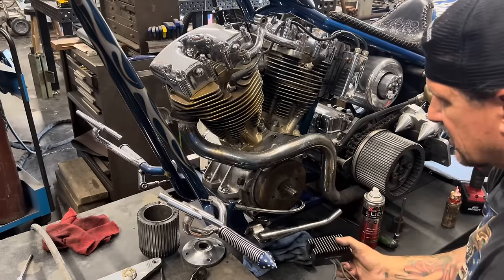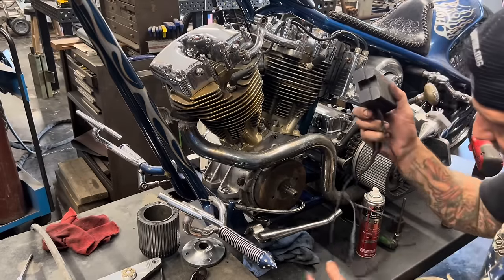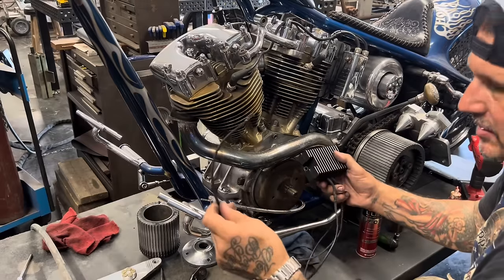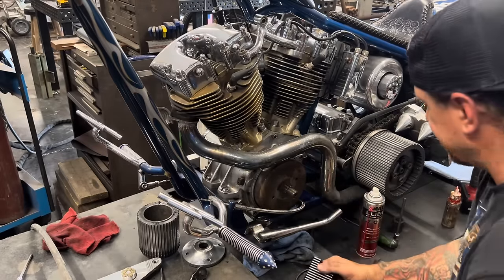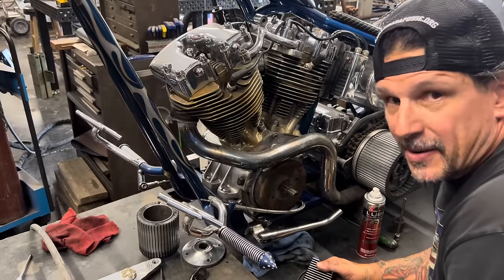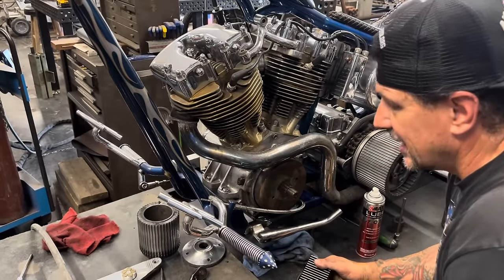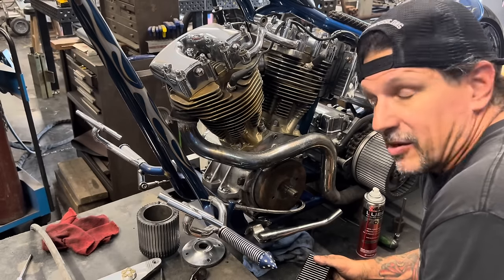And then once I get this installed, I plug it in, I tie the wires up, and I have to connect the battery lead to the circuit on the bike that's gonna charge the battery. I'm ready to put the cover back on, the pulley on, the belt on, and bearing cage, and fire it up, make sure it's charging. Check a few things on the bike because I've ridden it since March, and go ahead and take it for a spin.